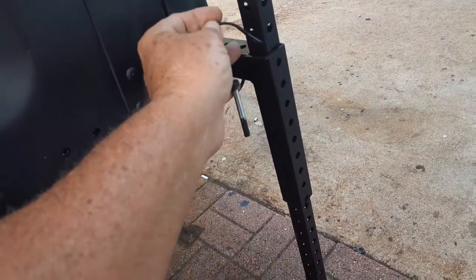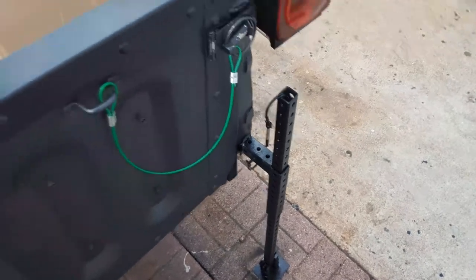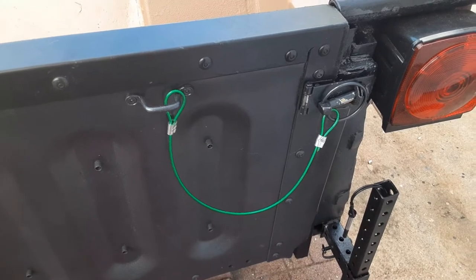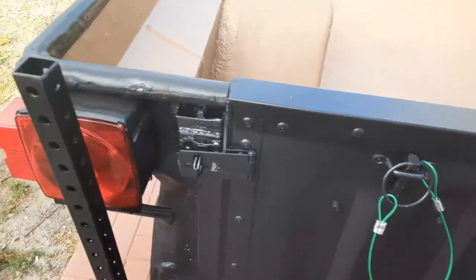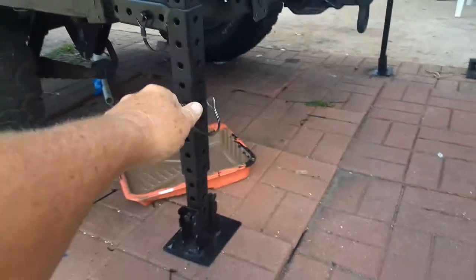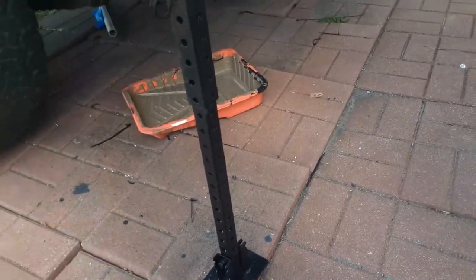You just insert the pin back into the stabilizing jack and it'll lock it in place. I only got two hands and one of them is holding my phone to record this. Lighting has been put on everything and it works. I used an M1101 tailgate and just created some really easy latches, welded it on both sides. So if you pull up somewhere you just pull the pin, it drops to wherever you need it, throw the pin back in, lock it in place, and you're stabilized.